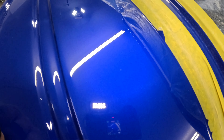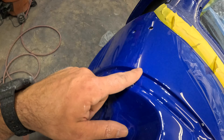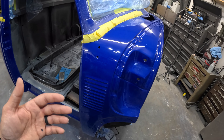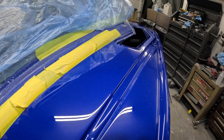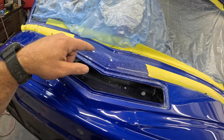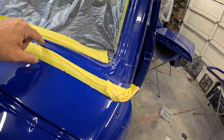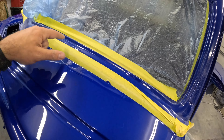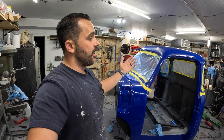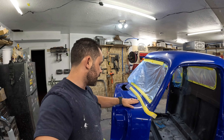The little spots I showed you — they're there, those two there. But just look at it. It doesn't take away from anything and if you're not looking for it, you don't see it. I'm blown away on how good that looks. Now I didn't do the small area over here because that's a 3-inch pad. It comes with a 2-inch pad too, so when I come over to do this body line, I'll use the 2-inch and knock out that little bit that's left. Unfortunately we're going to have to buff the body line too because there's orange peel, you want it to blend in, and there's also trash in it. Those little spots — I'm truly not worried about it. A year from now when this paint has seen some miles, it's just going to blend in with a little bit of defects that happen.